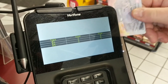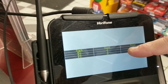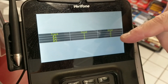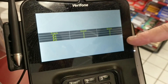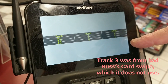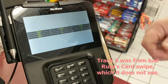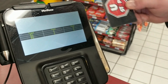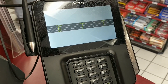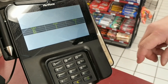Here's an in-house card — it only has one track, on Track 2, so you can see that count increased by one. There's no error on Track 1, and Track 3 shows up even though it doesn't have one — that's what would happen if it's not reading a track correctly. Same with this kickback card: Track 1 and Track 2 each bumped up by one. Most cards have two tracks on 1 and 2. To exit, hit the X button.